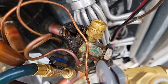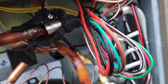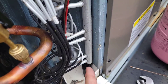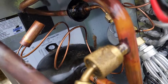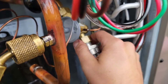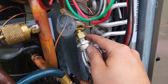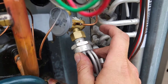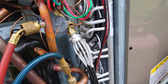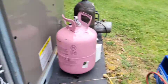There's one teflon ring on this side and then there's the other one. Now we can install it. There's where the bulb for the TXV is mounted, and that is the outlet port for the evaporator, which goes into the suction line of the compressor. I'm going to do a quarter turn past hand tight — half a turn at the most — and be careful when you screw it on because you can cross-thread easily. These aluminum fittings are so easily damaged, and then you'd have to get a whole new evaporator.